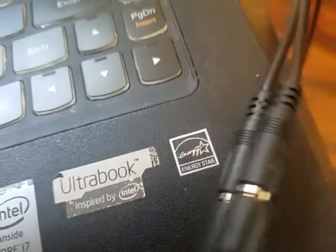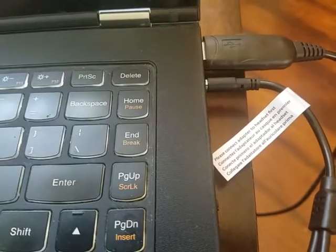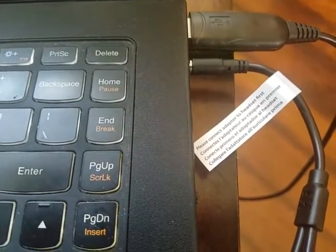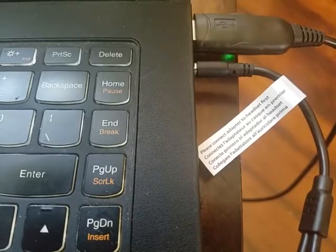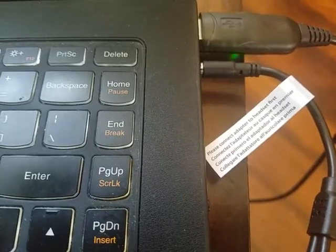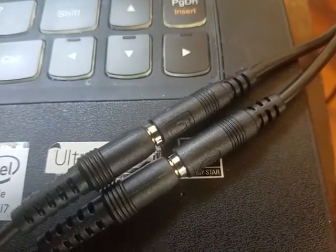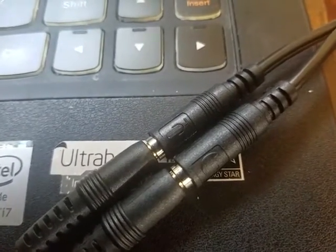This cord I ordered from eBay and it cost me about $6. You can find those on Amazon and eBay, and if you want to get it from a really reputable store, B&H has them for $6 as well. When you get one of these, make sure you don't confuse it with the simple headphone splitting cables which allow you to plug in two headphones and share the same music source. What this cord does is split microphone and headphones, so make sure you're getting the right kind, otherwise you'll be wondering why it's not doing what you expect.